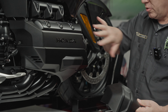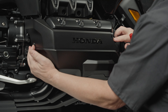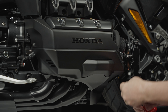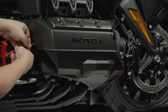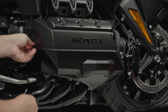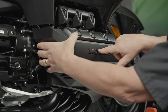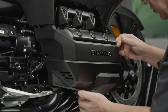We'll set this aside and move on to removing the rest of the plastic. The next two bolts we need to take out are this one right here and one on the back side. Again, these are five millimeters. Simply unscrew them. With the bolts out you can see it's loose here and loose in the front — just put some thumbs right here and pull out, because there's a little rubber grommet on the inside. It'll pop off like that, and then we move to the bottom.